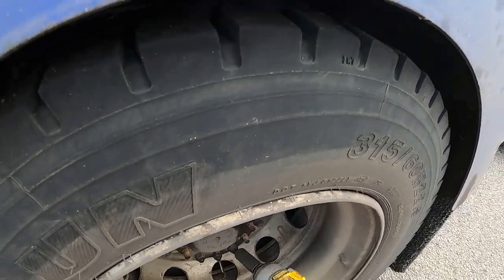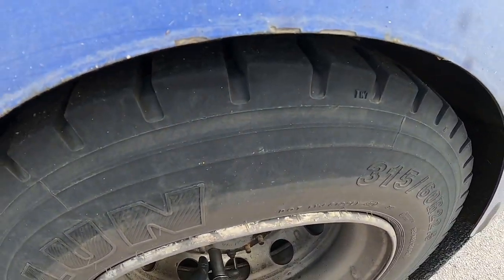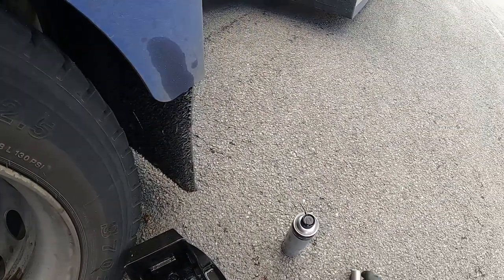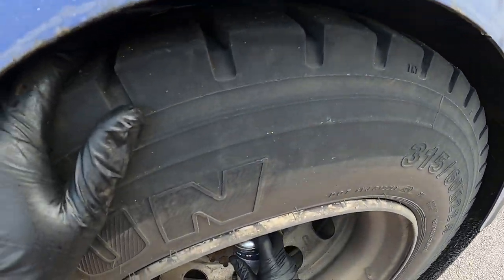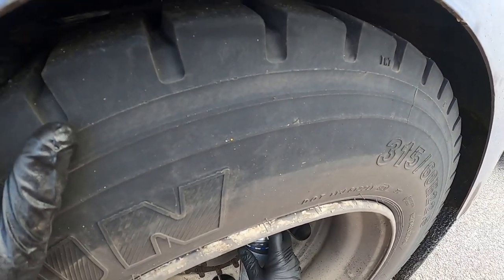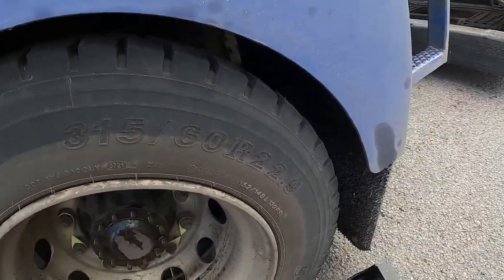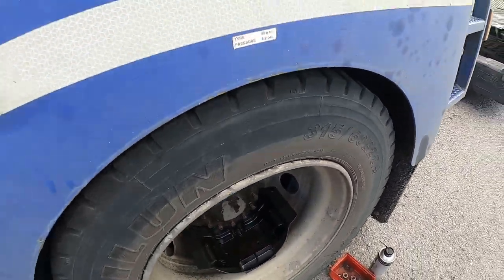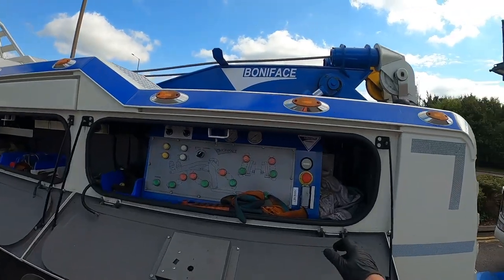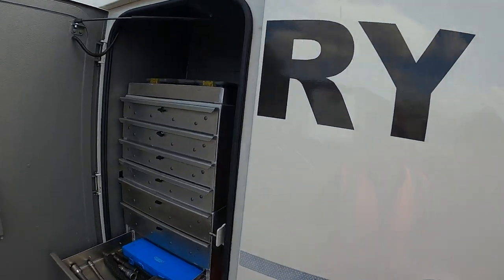This is the chosen way we would disconnect the drive. I'll pull out the half shaft, so see how it comes off. Right, that's all the bolts off. Little spray by the collars, in case of getting the sledgehammer out, and some rags, and see how we get on. Get me the tray underneath. Right, let's have a bit of rag, a bit of blue roll, and the sledgehammer.